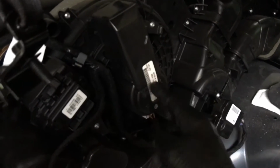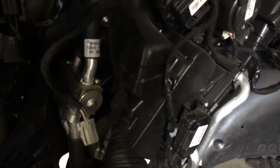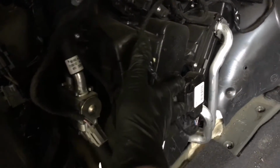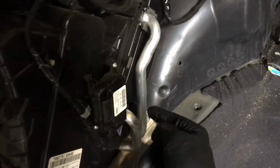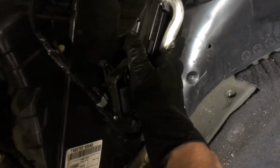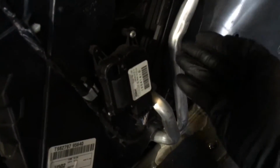And you can see how the air comes. Here's the blower motor, this round circular area, and the air blows in this direction. It goes on top of the evaporator core that is located right here. The air pushes through the evaporator core and then determines whether or not it goes through the heater core, through this area, right around past it.